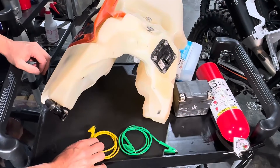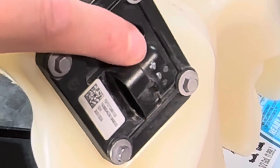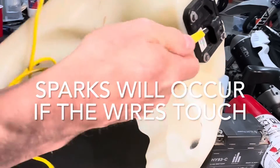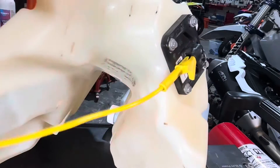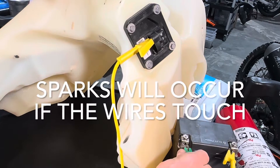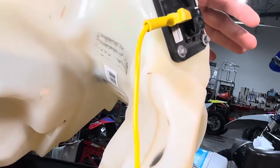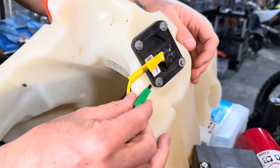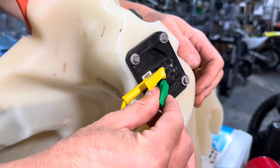For the second method, we're going to jumper into the connector directly. You'll see there is a plus and a negative — that's battery positive and negative. My technique is to first put the alligator clip in and grab the positive pin, connect that to the positive side of the battery, then connect the negative clip. This is a little sketchy — have your fire extinguisher ready, you're working with live 12 volt electrical. Then very carefully touch the negative to the negative post, and your pump is running.